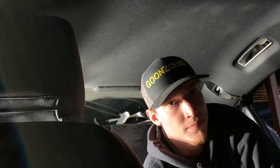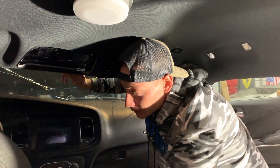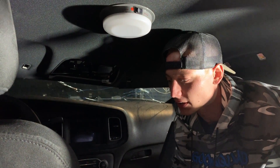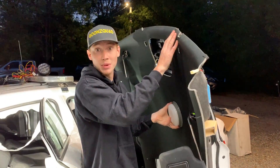So what you're telling me is we've got to remove this whole entire headliner just to get to these seat belts? That's right, because there's a bolt right behind the headliner. You could possibly bend it but you'd risk putting a crease in your headliner. Our headliner's already bad, so we're just going to remove everything. It's on one plug and there's a wiring harness of its own. I'll take that one screw out and this thing should pop right down. Headliners are always the toughest — somehow they have to go through a door. We'll probably remove the seats and go out the passenger side. That came out a lot easier than we thought!